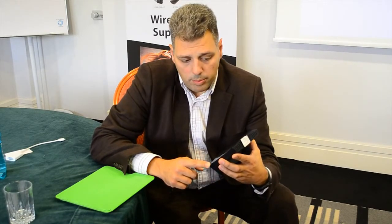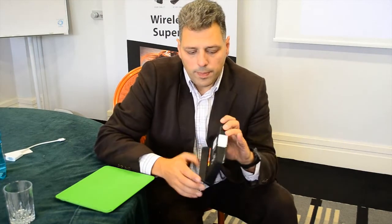On the lower end we have a price point that was in the past not possible even with wireless N dual band. This is our smallest wireless AC 750, having just one antenna for the 5 GHz wireless AC and one antenna for compatibility with wireless N at 2.4 GHz. So altogether we name it AC 750. It's the smallest and lowest priced wireless AC router on the market. This one, the DR810L, is based on the new MediaTek chipset for wireless AC.